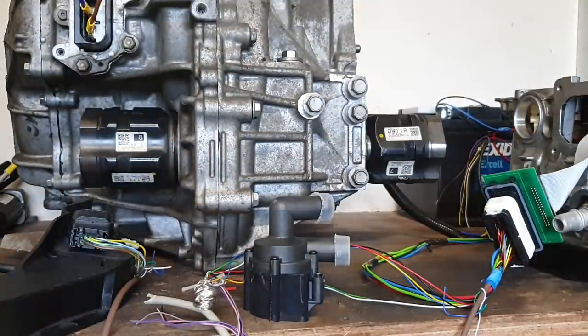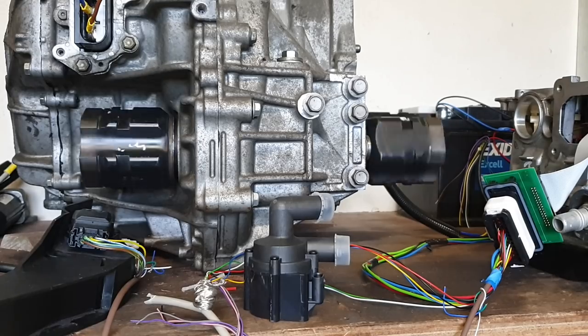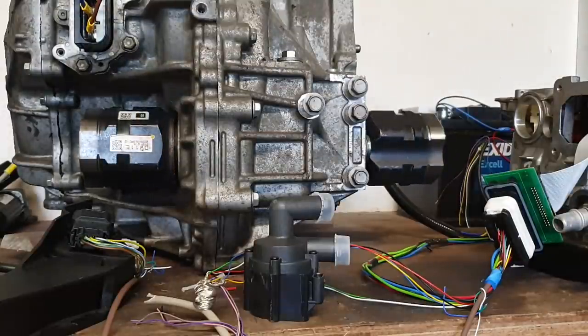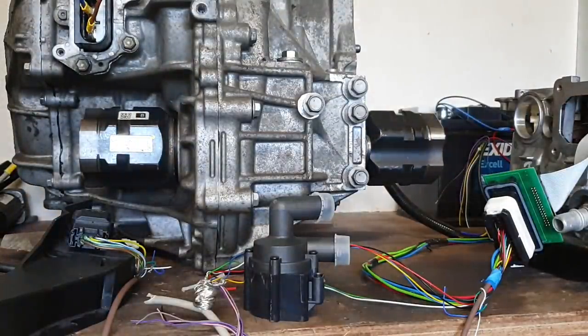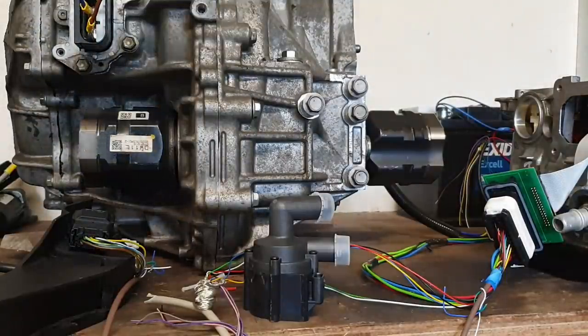So I now have my 5,000 jump. I'm going to go back. Do the very same 3 amps here now. Enter. Look at that, folks. It's not moving. Let's increase to 6 amps. Aha! I'm back to zero. Now, that's a vital clue. 3 amps made it move very quickly when we were at zero. 3 amps made it move reasonably quickly when we were at 5,000. But 3 amps could not make it turn at 7,500.